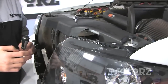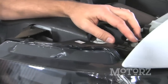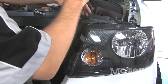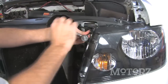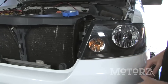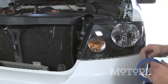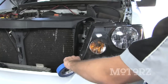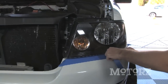Removing this headlamp lens on our F-150 is really easy. Just take a Phillips screwdriver and remove the plunger clip on top of the splash guard. Then take a 10mm socket with an extension, remove the bolt on top, and behind the splash guard there are two more. Once you've got the 10mm bolts out, you can remove the headlamp - there's a plastic clip on top that you need to pull up. Before you remove it, protect your paint with some rags or blue tape.